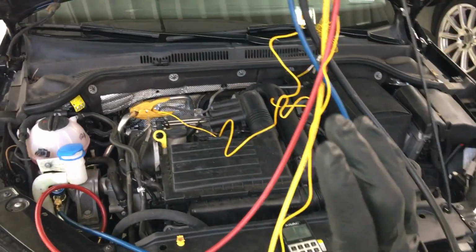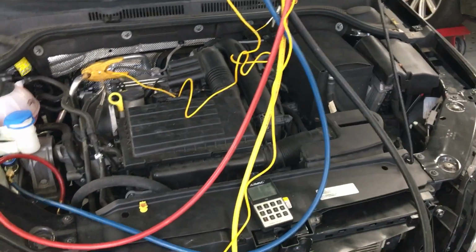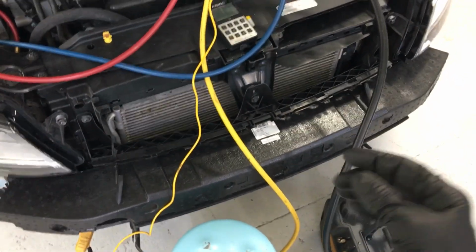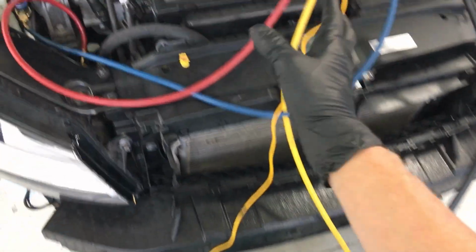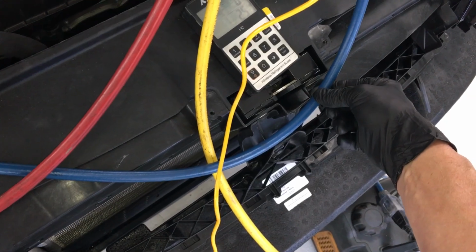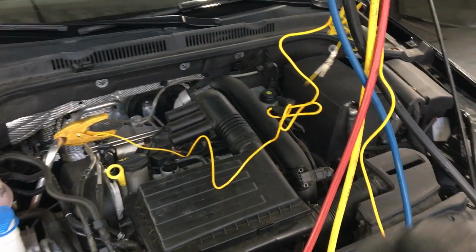And I can't even count the number of times that I've had vehicles come to me that came from a couple other shops or the same shop who tried to re-repair a couple times, and they were just learning, and they didn't understand that wind blowing on your scale, a car jumping forward, going in and out of gear, you shut the door and a hose moves because of the vibration, because the hose was just caught on a tip a little bit, and then the vibration, because it was under tension, it moved a little bit and threw their scale off. This happens so many times.